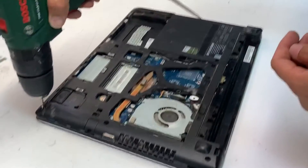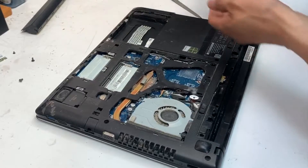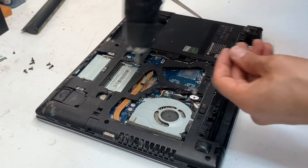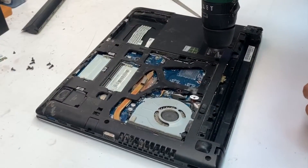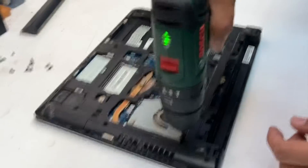The tools you are going to be needing for this one is a 00 Phillips screwdriver, and because we are doing fan cleaning we also need thermal paste, and if the fan has gone bad you also need a replacement fan. I am also going to do this video in its entirety because I want to include the full disassembly as well.